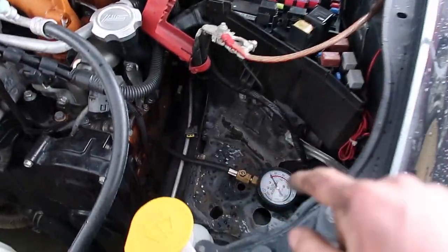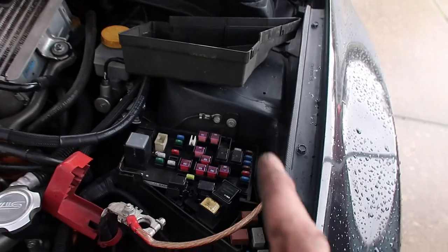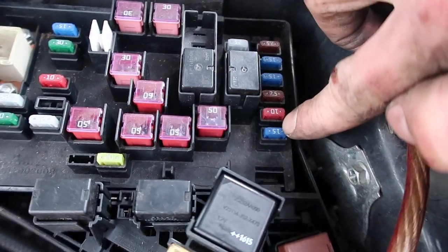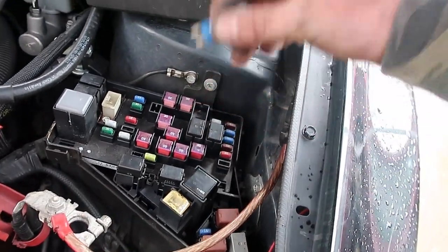It started pouring down on me so I got the tent out. Now we've got all our spark plugs and ignition coils out. We don't want fuel to the car and we don't want it to ignite, so we're going to pull this fuse right here — this is your fuel pump fuse. There's a little clip, pull that fuse out. Since I've already disconnected all the ignition coils, it shouldn't spark — it should just be power to the connectors which won't power anything. So I've removed the fuel pump fuse so we're not dumping a bunch of fuel into the engine while we're cranking.